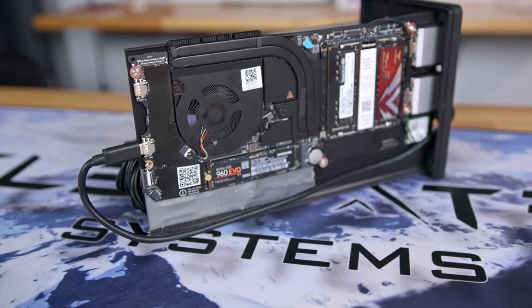The best I could track down were cards delivering 60 watts, which unfortunately can't power the Intel board without a second external power supply or backup from the laptop battery. While you'll have the CAD files to modify the enclosure to fit any PCIe adapter you manage to get your hands on, I'm also planning on uploading a version 2 of the enclosure design. This one will be a bit taller, making room to install the Framework battery below the mainboard. The increased height also means it will accommodate a full-size graphics card, and maybe even a standard SFX power supply. I can't promise a full follow-up video on this, but I'll definitely keep you in the loop with community updates and posts on my social media, so make sure you're subscribed. I'll certainly be posting video updates on my Patreon, because thanks to the amazing small community over there, I'm able to fund these creative endeavors.